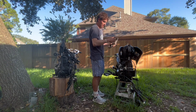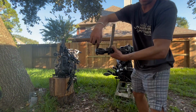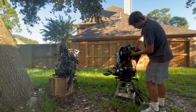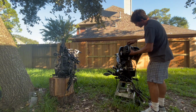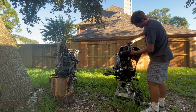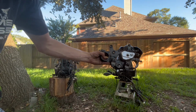Once you tap those bearings out of both bikes, take the races from the DLX and tap them in. Now this is the triple tree off the DLX. A lot bigger down here, a lot different design. This slides up into the hole all the way, as far as it'll go. Bearing on top. I'm not final installing it, I'm just showing you how it works. You still need to put some grease on it. You put your dust cover on, then this side down here, and you screw this thing all the way down. Make sure the dust seal sits in the middle between the bolt. And voila, beautiful. We have our Hawk DLX triple tree.